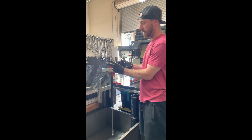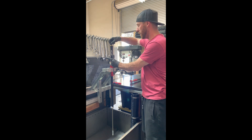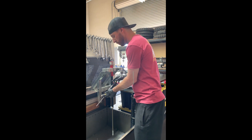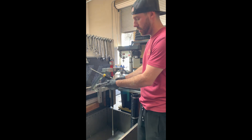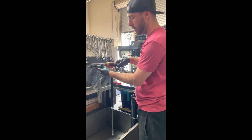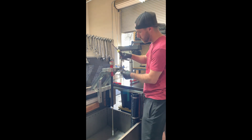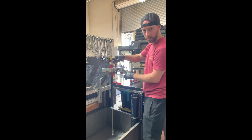If you have this tool, you set the length to 135, put it in and remove the oil. I already set it for this one. An easy way to understand why we're doing that: if we look from the bottom of our cap to where our free piston seal is, that distance is 135 millimeters. So our oil height in here right now is right where this free piston seal is going to seal.